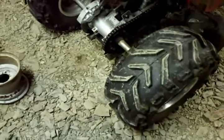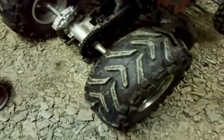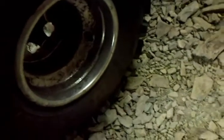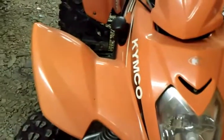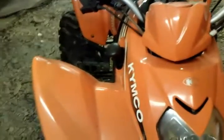You have to give it more throttle to pull out with these taller tires. These tires are 22s; the ones that were on it were 20s. So it's a little harder to pull out. I was trying to push a car, like Rick's once. It pushes, but those big tires messed up my gear ratio, and you can smell my clutch burning.